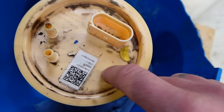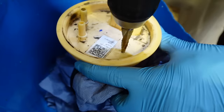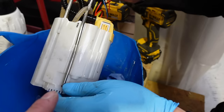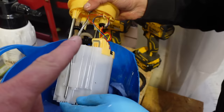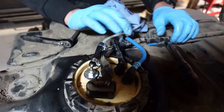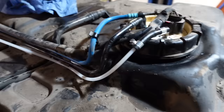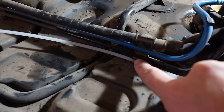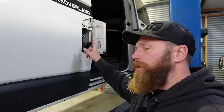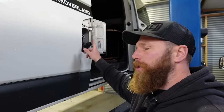On the fuel sender there is a location - mine had a yellow sticker on it - because you can get diesel heaters fitted from factory, and that is the location where the factory fuel line would be. We're using a step drill here; if you put an 8.5mm drill bit through it can snag and cause all kinds of damage. Our new fuel line sits in there, ready to pick up straight out the top and off to our heater. VW provide a clip for the fuel pipe as it's a factory fit option.